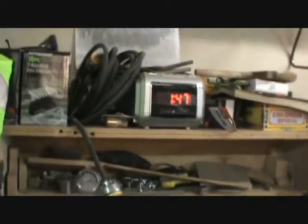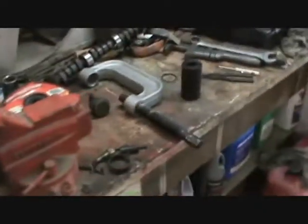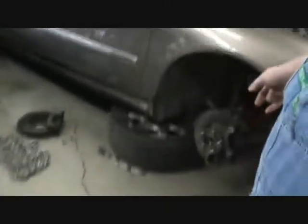So almost 14 hours ago, because that's gone past noon now, I come out here and started on this car. Needless to say, the car won. It's still in here. It should have been done. But I got the struts in. Then the guy got me the ball joints late, so I didn't finish it last night. I did come out and put one of them in, and this time using my ball joint tool here, which consists of this. And there's the one ball joint I ruined the threads on, and that ruined it, out it came. But I've got the toolkit right there. Used that last night and put the new ball joint in this side here, just lickety split.